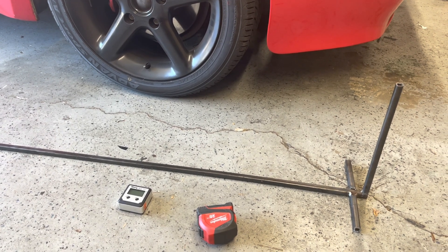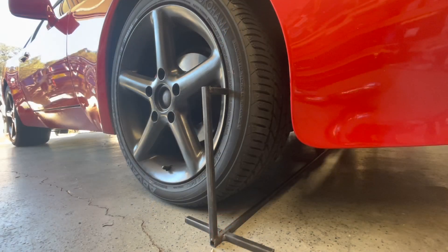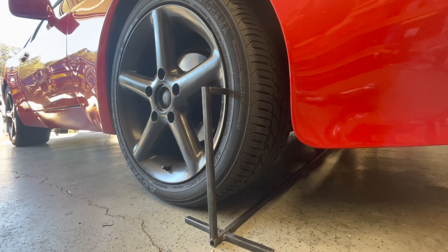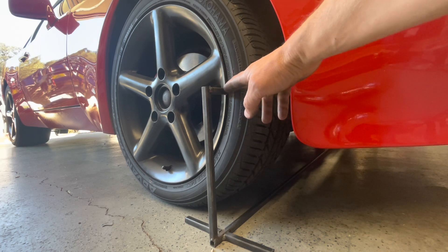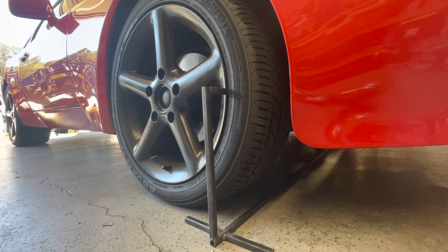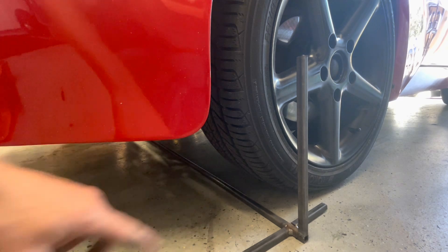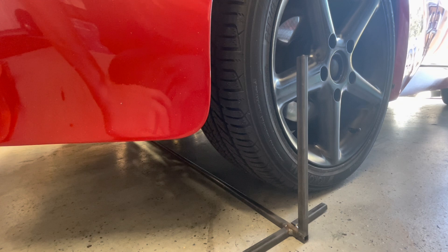Here's how to use it. I measured the height of the tire and wheel beforehand and built the jig to sit in the middle of the wheel — at the three o'clock position. If twelve o'clock is top and six is bottom, the jig sits at three o'clock on the passenger side. This gives us a consistent baseline to measure against on both sides of the car.